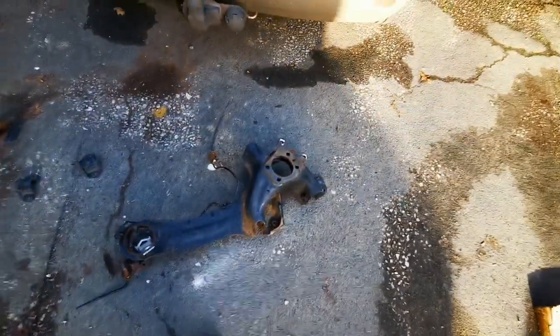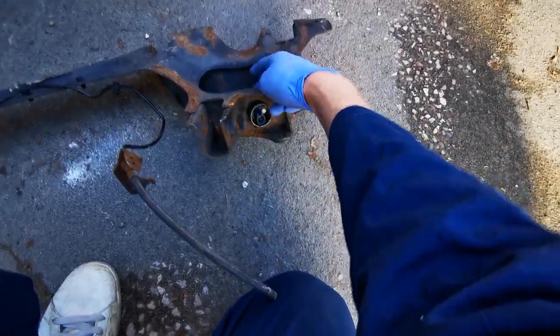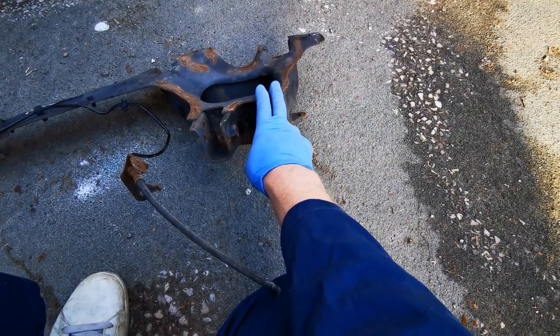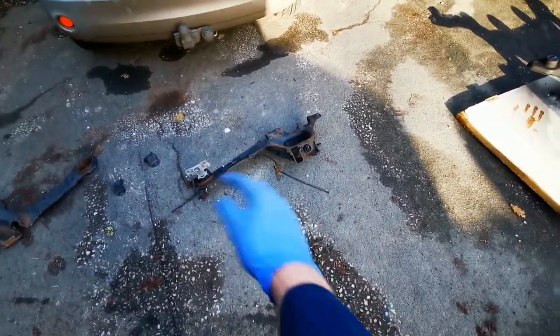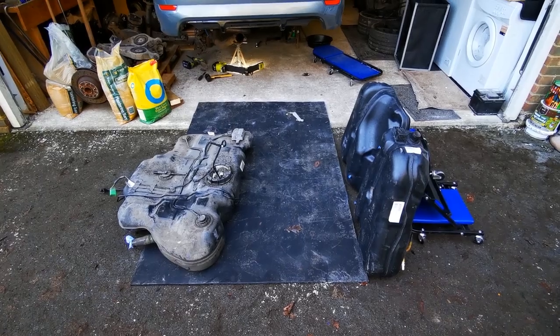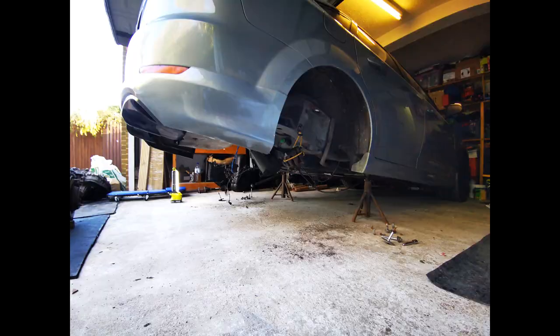One thing I did notice while I was fiddling around: the position of this ABS sensor on the all-wheel drive ones is on top here, so it obviously gets the signal from the shaft rather than the bearing. On the Mondeo one, it's actually on the back of the bearing — so that is something that is different on these. Hopefully there'll be some progress next time — painting these bits and giving another coat to that. Hopefully we'll be a few steps closer next time. Thanks for watching — subscribe if you want to follow along, and leave me a like if you can. Cheers guys, bye!